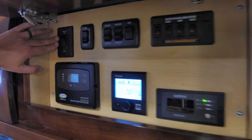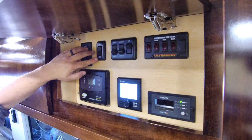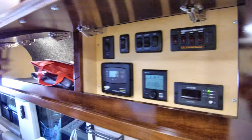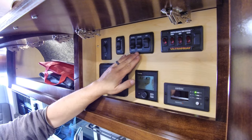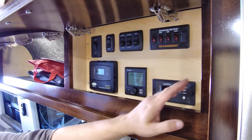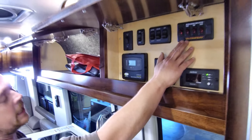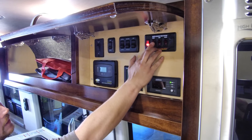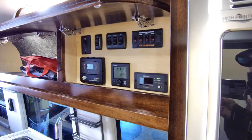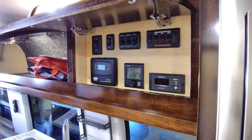You have a solar panel on/off switch in the same cabinet to turn on and off the solar panel charge. There's a battery disconnect for your 12-volt battery — storage position for when it's stored, use position when you're using it. Motion lights are for the in-cabinet lights, which are motion activated. Ground effects are the outside LED ground effect lights. There's also a Wi-Fi ranger — that switch turns it on and off, and the login information tag is to the right in that cabinet. Tank heaters for the holding tanks are all located here — for the fresh, gray, and black tanks — and they keep your tanks from freezing down to around 20 degrees. Below 20 degrees you don't want to count on those, so I'd recommend having the unit winterized.